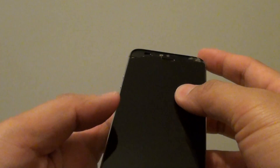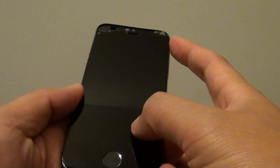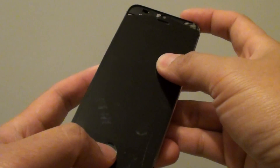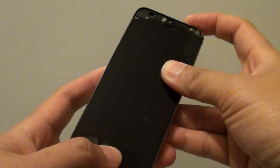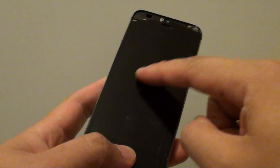The first thing to do is if you press the power button and it is not turning on, try pressing the power key and the home key both at the same time for around 10 to 30 seconds. Press and hold both keys and hold for at least more than 10 seconds until you see the Apple logo appear.